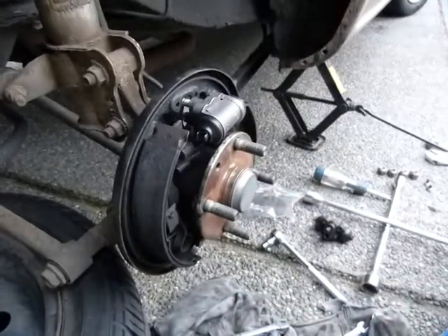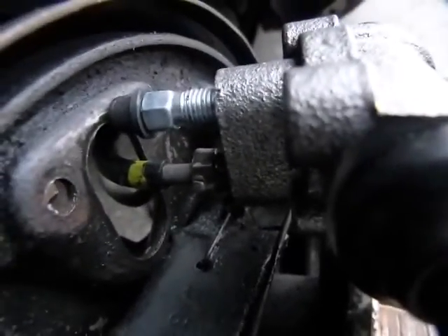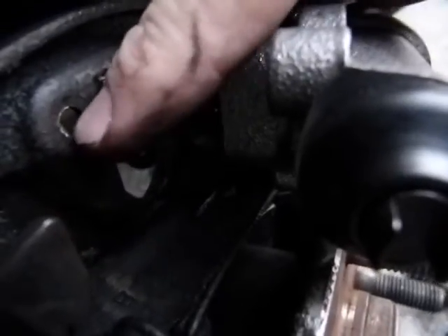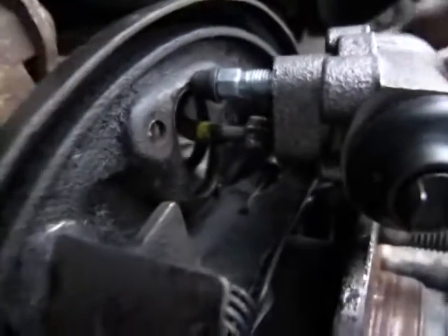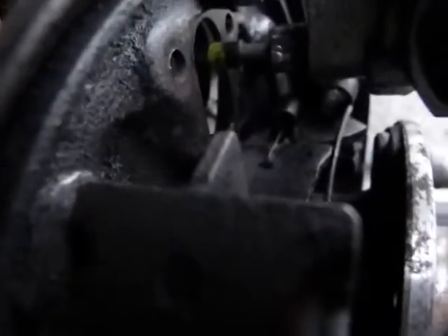Consequently, the brake line matches it. The brake line is rigid but it has a little bit of give. And you can see that's how it looks installed. That's the hole in the backing plate here that the oval shape is going through. That's where you put the bolts through. And you're gonna have to turn it with your wrench. I'm gonna show you in a sec how this connection is made between the brake line and the wheel cylinder.